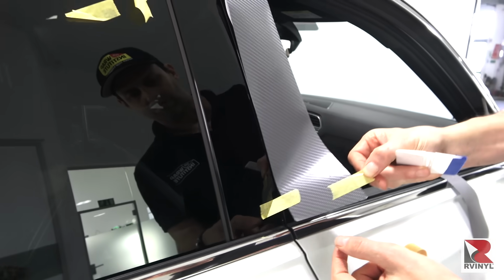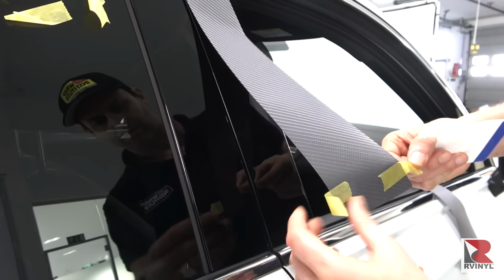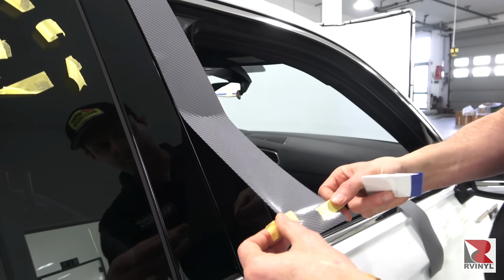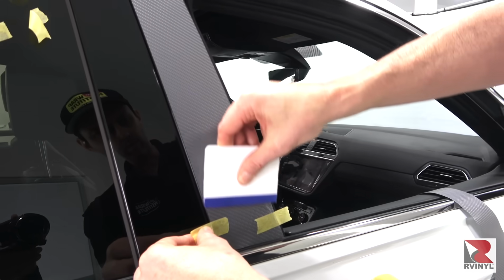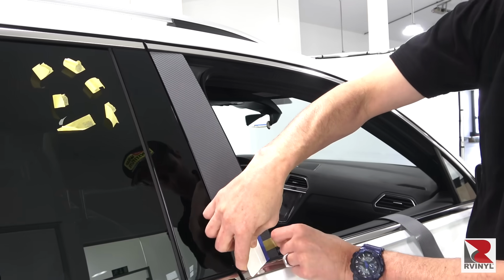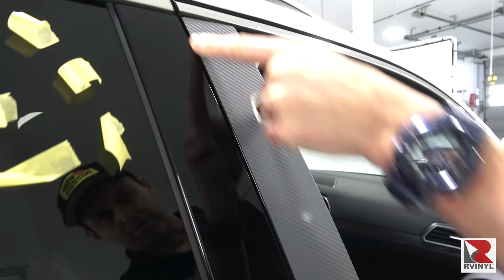Then take the entire liner off, but first pull on the masking tape so the fingers don't get on the adhesive side. With 2 hands now, it can be guided with perfect alignment towards the bottom. Pull evenly, low and flat. Once onto the pillar, simply take the squeegee and squeegee from the top towards the bottom. Be sure to hold the squeegee on the piece while the masking tape is pulled off the bottom, and the last step is to run a finger on the edges to make sure they are fully sealed.